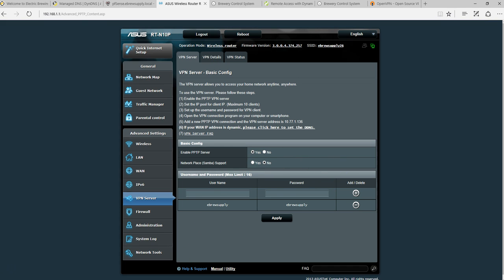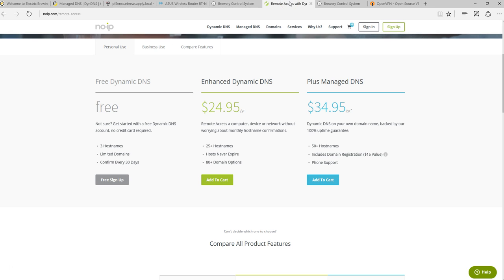So definitely try for VPN. Most name brand routers will offer some form of VPN. So if you can, stick with Linksys, Asus, Netgear. Wow, lots of names. It's a fairly good list of name brands that should support a lot of the OpenVPN, PPTP, dynamic DNS, a lot of these services. But the key is you want to make sure you have a dynamic DNS account or No-IP account. Take your pick. Obviously, No-IP is free, so big plus there.